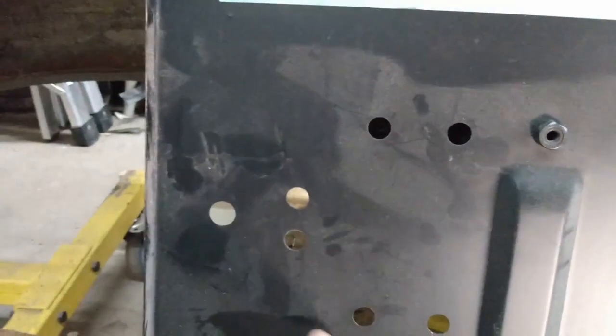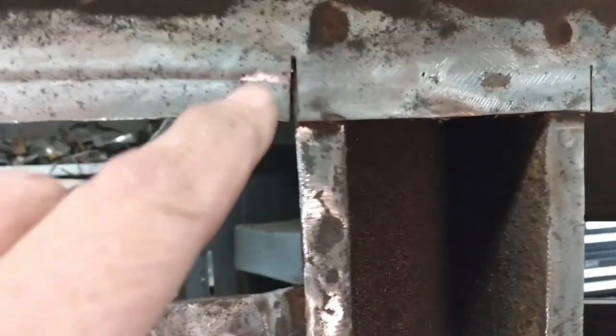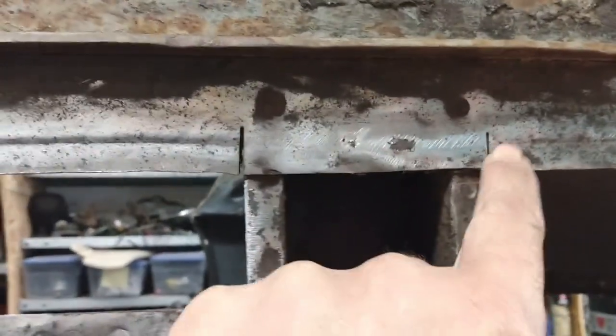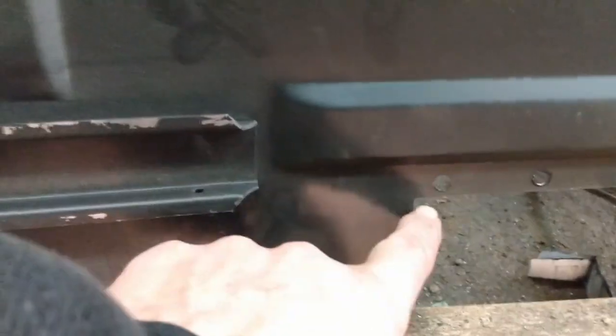I've started marking out the floor pan where I'm going to cut it. This is the back, and you can see the holes that match up with the holes up there. I'll be cutting down to that line there. So this will go over top of the flange until I get to this spot here where I have to notch around this part here — I can't cut this out because there's another bit welded in from the top side. So my floor pan will come across the top of the flange on either side, and then it'll just notch down and that will be butt welded through here. Then we go all the way to the front, and we'll cut up this line out there. So that's that side measured out — cut down here, straight across here, and then up and over past these two.